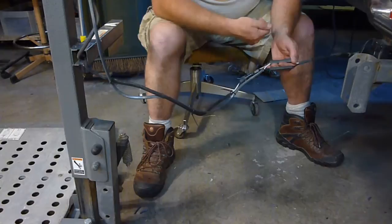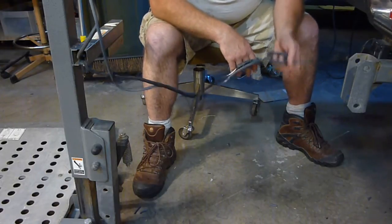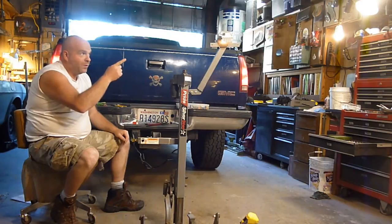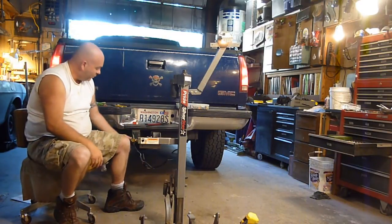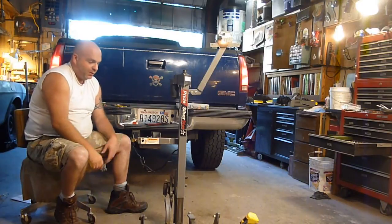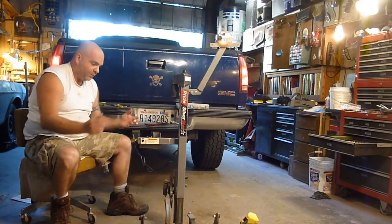The only way power goes to this is when I switch the lights on. If I went through the larger trailer plug I'd have power all the time, but with this setup I won't have power unless my lights are on. I figure that's fine — I drive at night anyway, and this light was made to be on whenever lights run. I'm probably not going to use the license plate light since this goes on different cars, but I also figure it'll be nice to have a light up there when it's dark. So I spliced it all together and I can just use what was already on this machine.